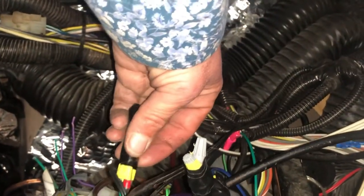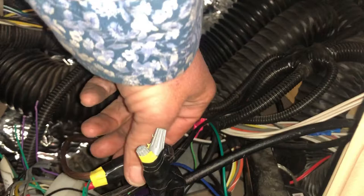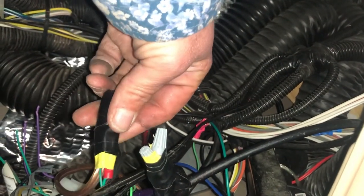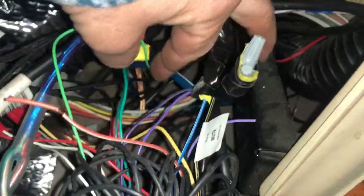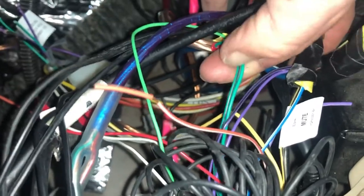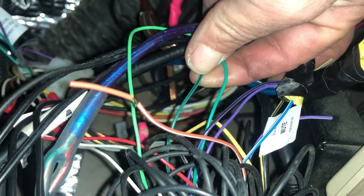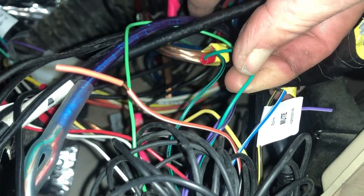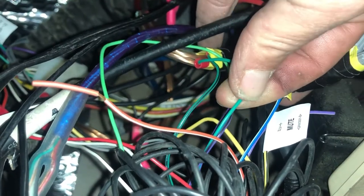It's like the primary emerald green. So, the green wire — not the lime green one, that's a different one. You have solid green (your positive) and green with a black stripe (your negative). You put the positive on the fat prong of the speaker terminal, and the negative on the skinny prong. There's two prongs — a fat one and a skinny one. Negative is skinny, positive is fat.